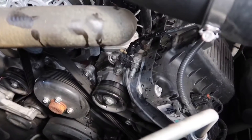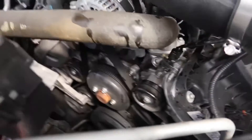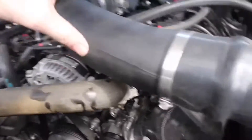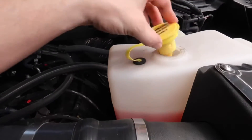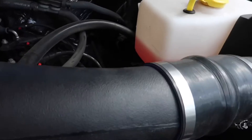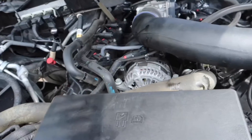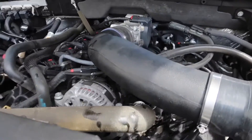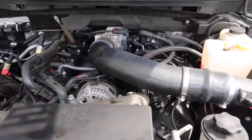Alright guys, I think I got everything done. Bolts are in and secured, shouldn't leak. Got the new thermostat in, but I made a little more mess than I thought I would. I'm going to hose the engine bay down. Got the cap on and the overflow bottle sorted. I'm going to go ahead and start the motor and see how far the coolant level drops before I top everything off — trying to bleed the system real quick and then wash everything down.